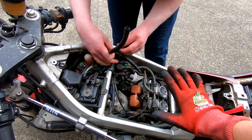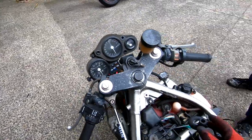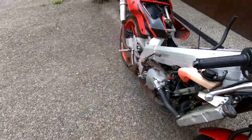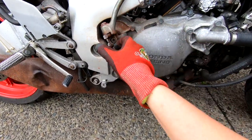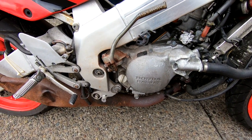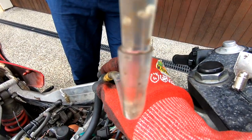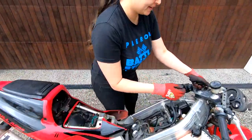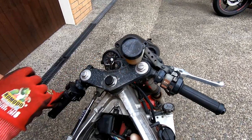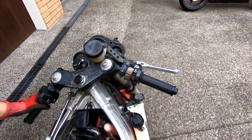We're not going to be putting the fuel tank on the bike. We've got a syringe and we're going to be pumping the fuel from the syringe in and then trying to kickstart the bike. I gather there are easier ways to start a kickstart-only bike by removing this and attaching it to some kind of ratchet or drill, but we don't really know how to do that, so we're just going to do it the old-fashioned way — leg day. There are two things you have to worry about when getting a bike ready to start: the ignition switch, and this little button here that says run.